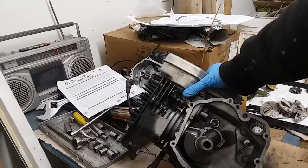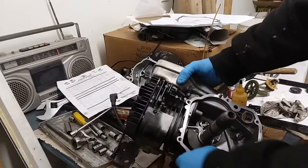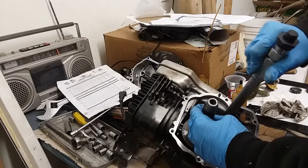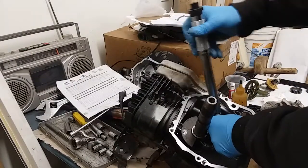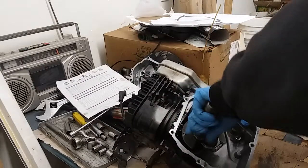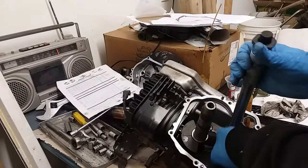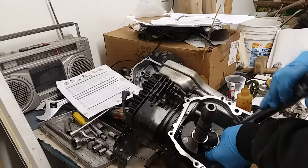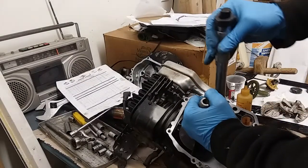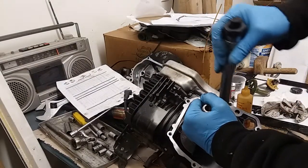Okay, you can see there we're getting pretty close on the gap, so we're almost ready. We can start to tighten this down. Now I can feel slight resistance, so I'm going to set them both down at that point. You've got to keep moving this around. A little bit of resistance there - just keep alternating. Remember, this is going into aluminum. We're not going to go crazy right there.